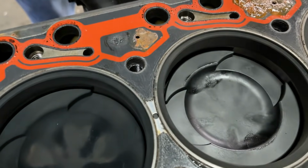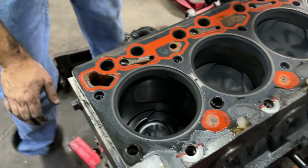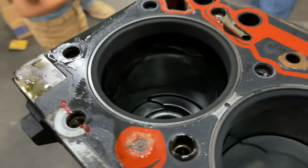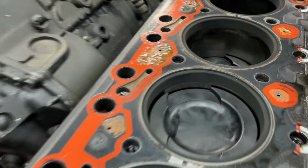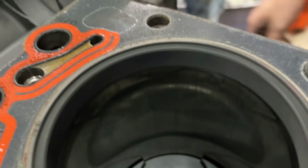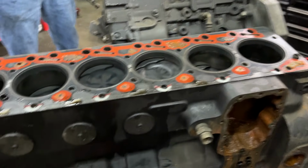Dude, I thought I had piston wall. Oh, dang. Now, guys, to be fair, with a forged piston, you do run a lot more piston wall than a cast piston, but it didn't scuff too bad. Oh, dude. That'll have to go up to the next size. Man, for 400 horsepower, I would not expect these kind of scuffs. Interesting. Well, there you have it.